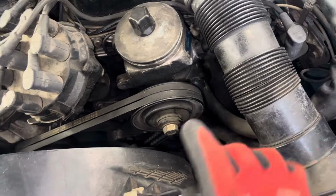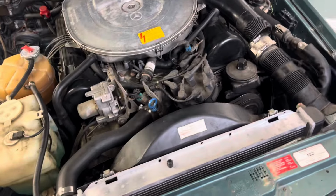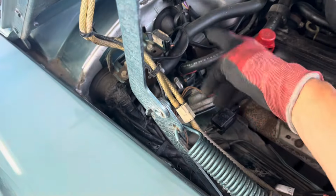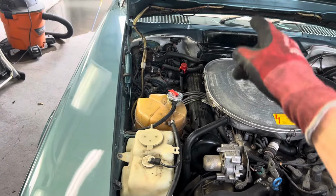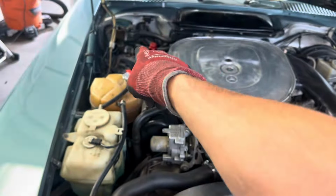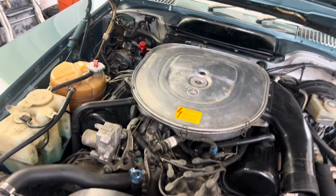Now, this compressor was notorious for front shaft seals going, so it may fail either immediately after I charge it up, I'll pick up a leak, or 500 miles later. That compressor just has that problem. These get old, they have problems, and the heating stays on, so there'll be hot coolant going through the heater core, and the heat always wins over cold. So even if you have good working air conditioning, those malfunction. There are updated aftermarket retrofits for those, and supposedly there are some guys who actually take those apart and rebuild them.